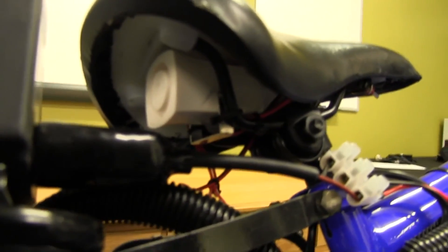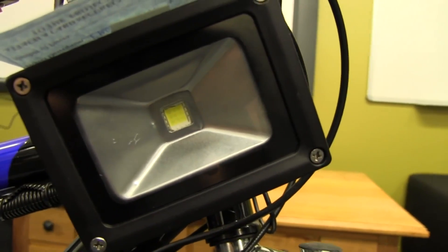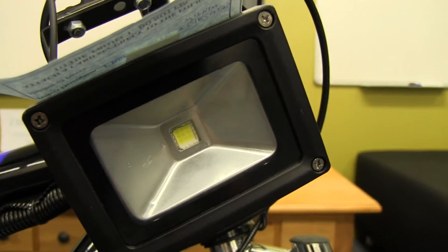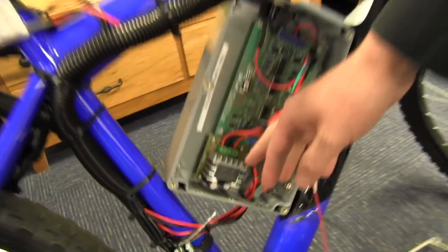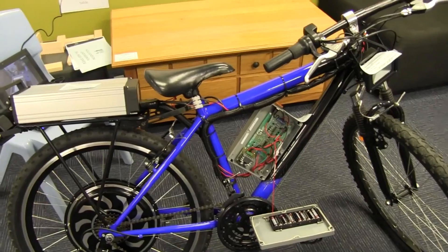There's the screamer — there it is. On the front we've got a 10-watt LED; it's really, really bright when it's on — you look at it and you've got stars. I suspect it's the cheap one from China. That's powered through a little step-down switch-mode converter here — it takes anything up to 50 volts input and steps it down to 12 volts for the LED. The LED has a constant current source in the back of it.